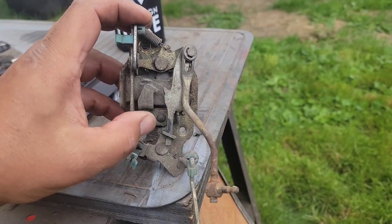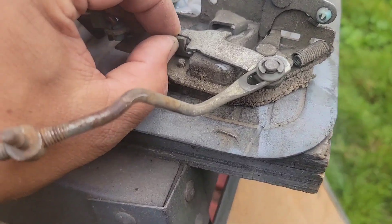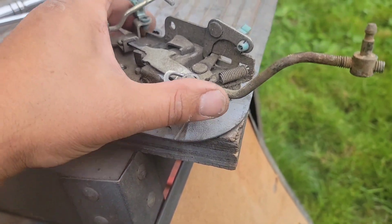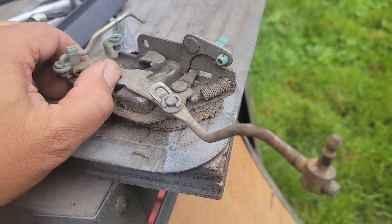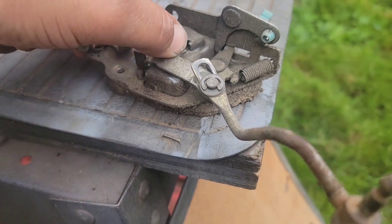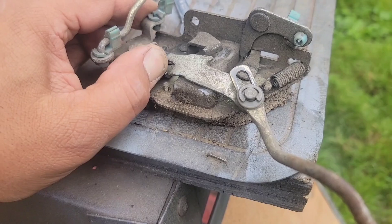This is the main problem here — you can see all the play that's involved, especially this one. See that? You can see the worn down parts right there. What happens is, when you go to push down on your door handle, it pushes down to here and then pushes on all this other stuff, but it kicks — it doesn't grab like it should. It doesn't make it quite far enough into that latch to unlock the door, so as you're pulling up you break your door handle.